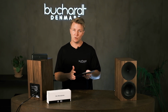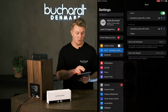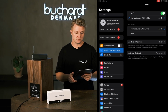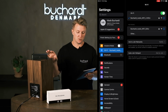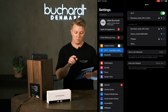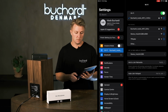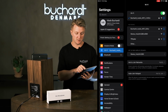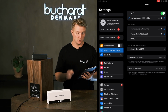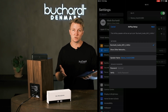So grab your iOS device. Right now I have the iPad right here, but it can also be done on an iPhone as well. You go into the settings and you press the Wi-Fi, and this is of course where you can see all the available Wi-Fis. When the hub is ready to be set up, it will pop up as an AirPlay speaker. So let's just wait for that to happen. Okay, now we can see that we can set up a new AirPlay speaker, and that's the stereo hub and a bunch of numbers. So let's press on that, and it will ask you what kind of Wi-Fi it wants to be set up for.